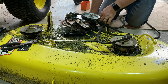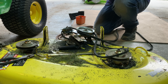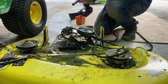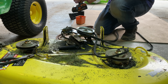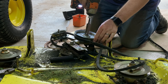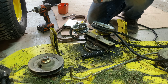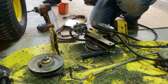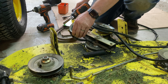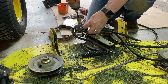First thing I want to do is take this spring off to release the tension — so we'll just pull here. Now to release that tension further, we are going to grab our 13 millimeter socket and take off this cover, as well as loosen these two bolts by the supports that keep the belt in place alongside the pulleys. If you're just getting started in a garage and don't have these tools, I'll put Amazon affiliate links to a 15 millimeter deep socket, a 13 millimeter regular, a 3/8 inch wrench, a pair of pliers, and even this rigid gun.